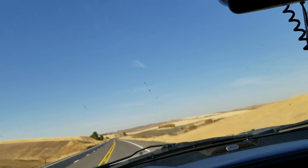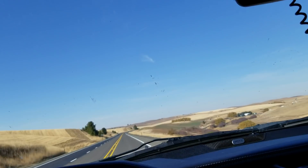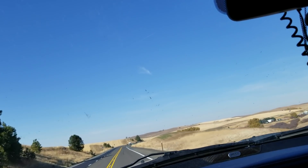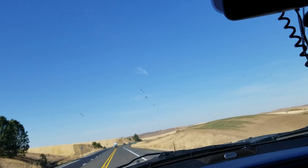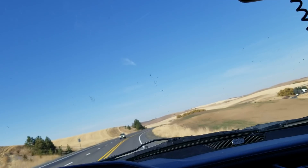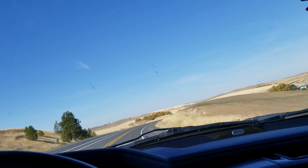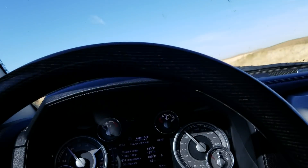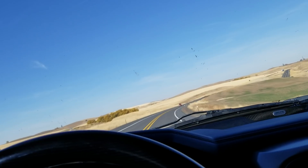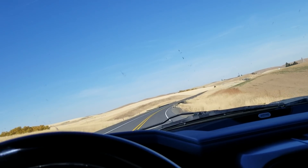That truck is the only truck I have with 625 head studs — and it didn't need it. I've got trucks that work a lot harder than that truck with everything stock on them and they're not blowing anything. Even as a tow rig, a stock 6.7 versus a 30-horsepower-tuned truck that's fine-tuned — if that 30-horse truck doesn't hook up to a gooseneck very often, it's going to see a lot less stress on that head gasket than the stock one that's towing day in and day out.